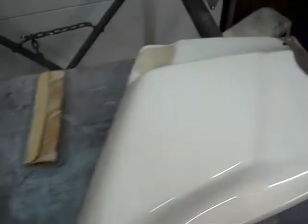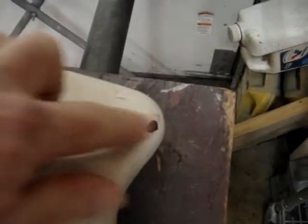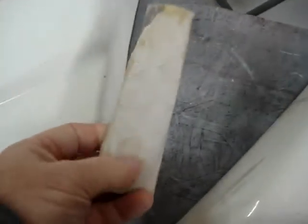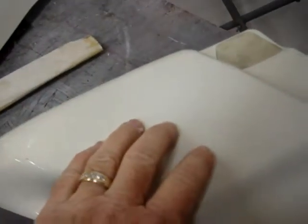Very nice. But after we painted the saddlebags, these didn't quite match, so now we're going to do these two. They're in good shape. Little rub mark here, rubbed on a crash bar. We're going to get rid of these pads. I'm going to paint at one time, the originals. They are plastic. So what we're doing now is we're scuffing this with this in 320. We'll scuff this down and we'll prime it. I'm not going to take the paint off because then you have to worry about prepping the plastic for adhesion. Harley's already done that for us here, so we'll scuff this paint and keep it on here.